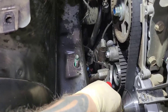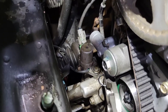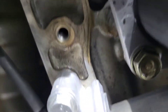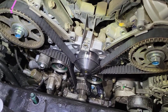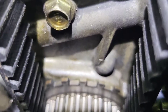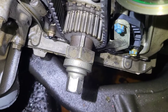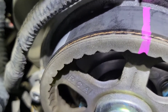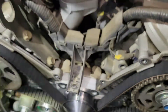Now we've got to pull the pin on the tensioner. On a Honda and Acura you can use dykes to pull it out. On this one I had to use some big pliers — put it up against the pulley, use the leverage, and pull it out little by little and it will pop out. A lot of times you can hear the tensioner make a little thunk when it comes out. You'll be able to see that the tensioner is up against the pulley assembly. Now roll the engine over two full revolutions and confirm that everything is lined up. The keyway on the crank is where the mark is on the crank sprocket, and you can see the mark on the engine. Check both cams — sometimes the cams will appear to be a half a tooth off, but there's no such thing as a half a tooth. It's either a whole tooth or it's not. This one is in perfect time; you just can't see it right.